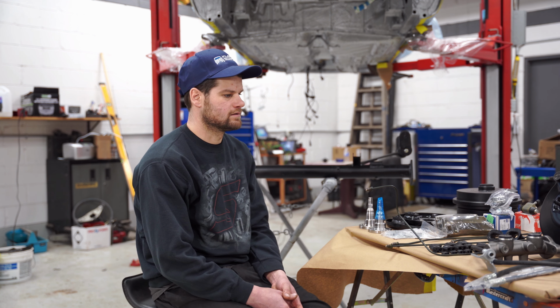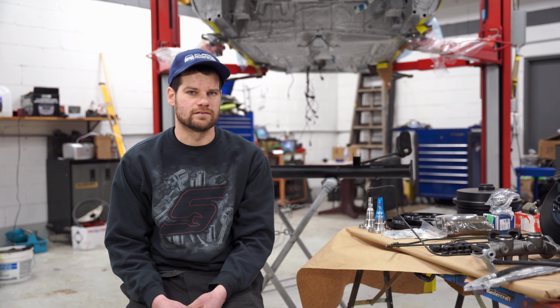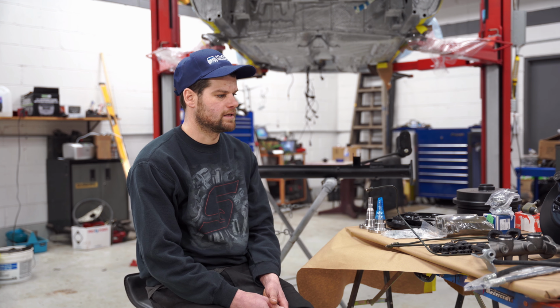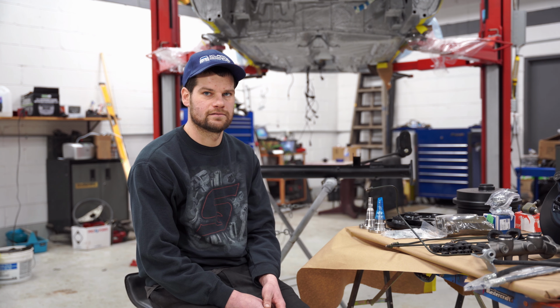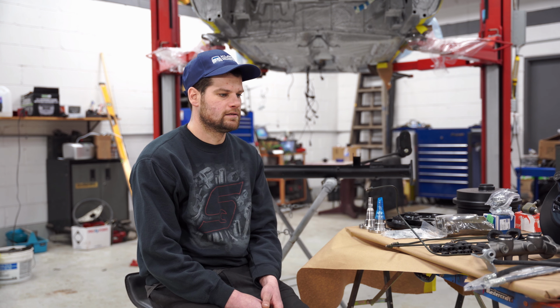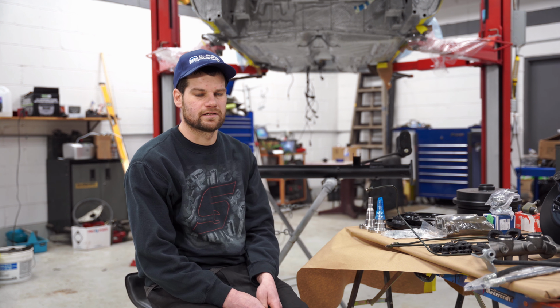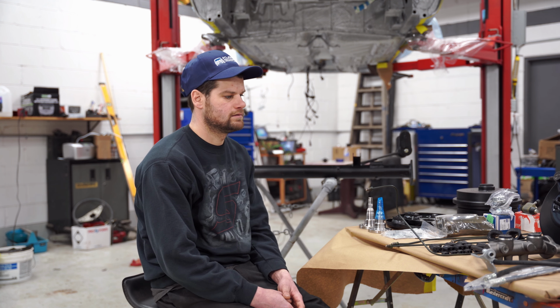We're going to be installing all the brakes and rear suspension and gas tank. I bought everything new that I could for it, but there's lots of stuff that's discontinued already for the pickups. So I made all the brake lines and painted them a dark green that I mixed up to be like the factory coating. Brand new master. All the suspension, gas tank, and booster was sandblasted and painted.